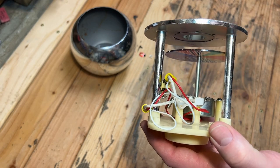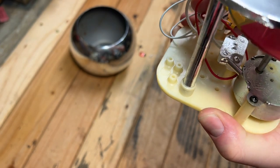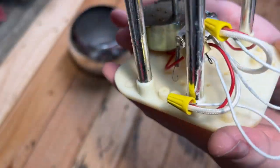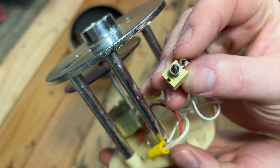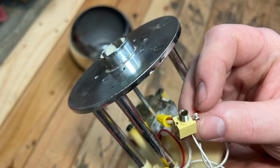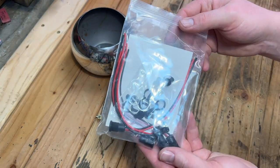Let's turn the light that way a bit more. Obviously we have our synchronous motor - wonderful company, I cannot read anything. We have our little socket for the halogen bulb, and this was the plug for the power adapter - it looks like a headphone jack. I have some novelty lamps back home that use power adapters like this. That's probably to prevent you from using a DC adapter by accident on an AC assembly. As you can see, this is going to be quite easy to remedy because it's just wire-nutted on there, and that's what we have these new plugs for.